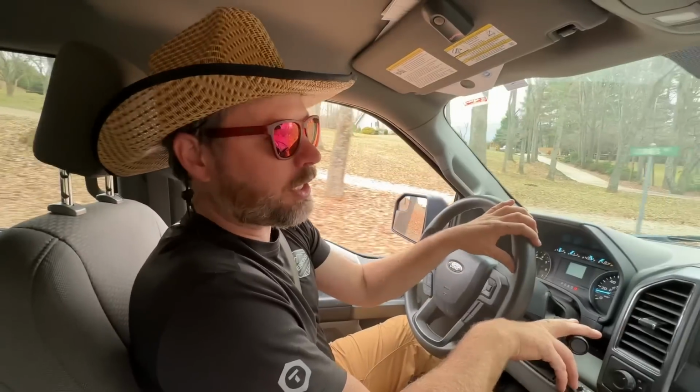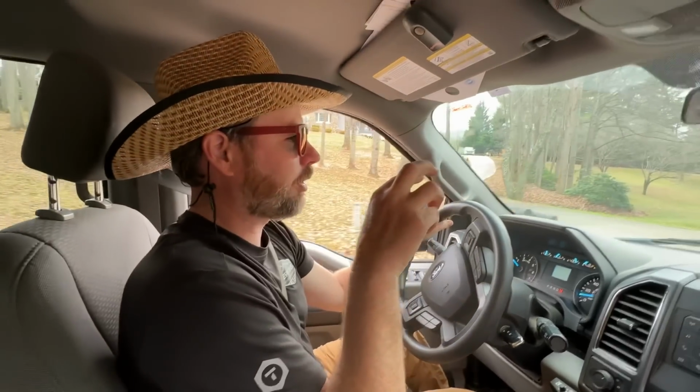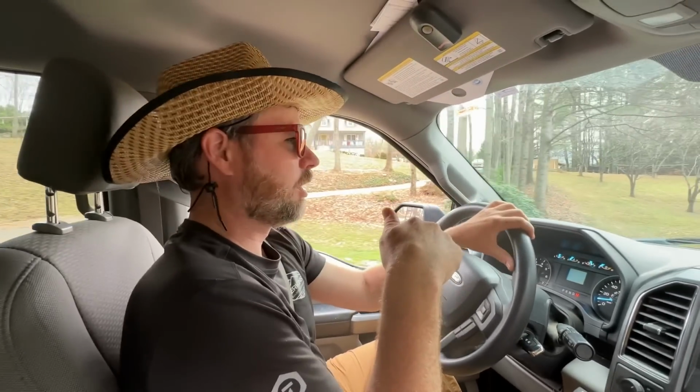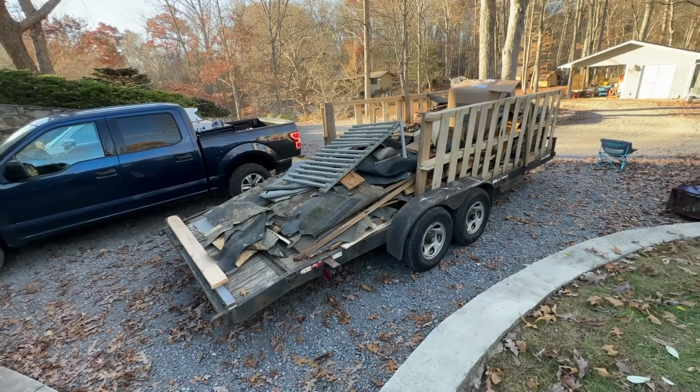Doing the trash run, and it seems like a truck like this would come with the connection that gives you trailer brakes, but this one didn't, and I haven't had it done. So when we go down this big hill where we've got to stop right at the bottom, I'm going to go four-wheel low and just let it crawl because I'm not real sure. We probably have 5,000 pounds behind us and a 20% incline I've got to stop on.